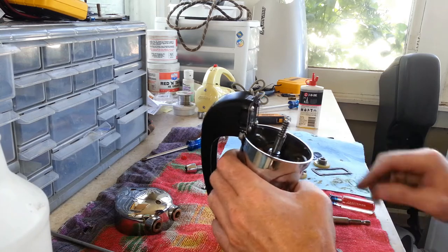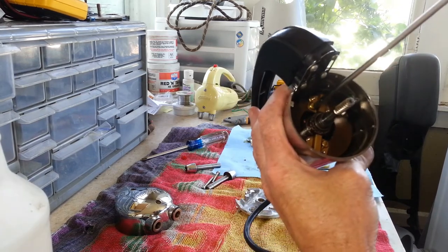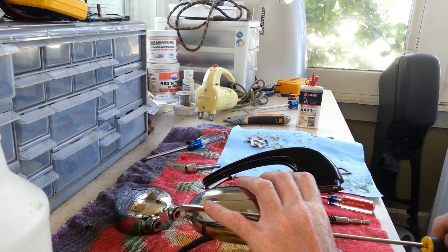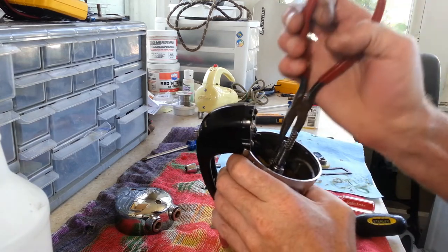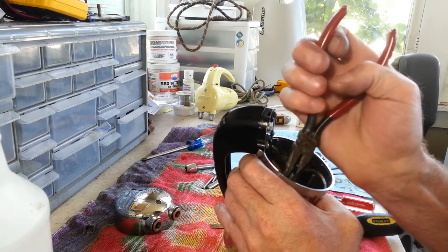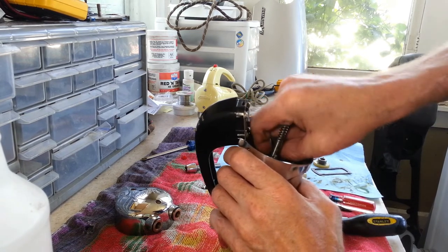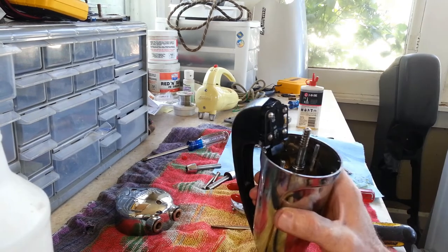And I will show you guys the other way to pull this apart without having to pull everything out. These two screws right here on these wires, just take these screws off. And then your nuts down here, just loosen them up and then spin them right off. Unless there's a thread that's got a bugger on it or something, once you loosen them up, they should be able to spin right off all the way up the threaded rod here. As I say that, I hit a tight spot. Okay, so we've got those off.